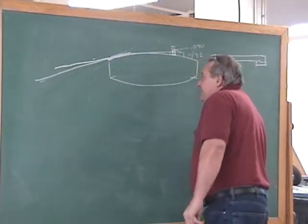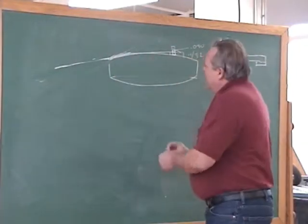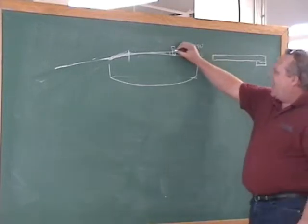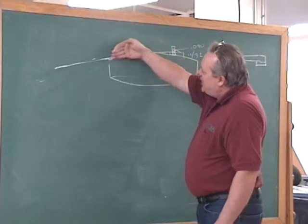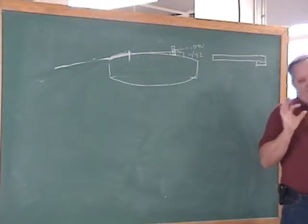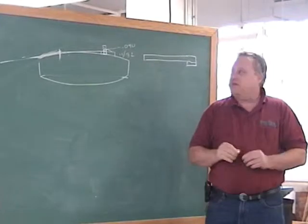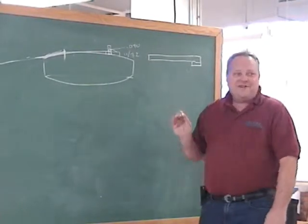That's what should happen. You've got about 3 inches right here where the tongue meets the body. This 90 thousandths should line up right with that. If I lay a straight edge right there and measure down here, 90 thousandths is perfect. 1/8 of an inch is a little high. 1/16 of an inch you can get away with. But that works out ideally every time.